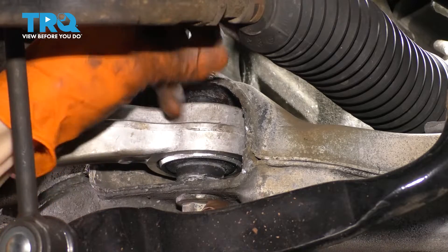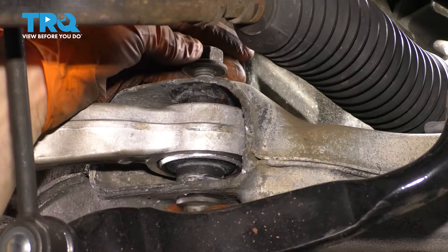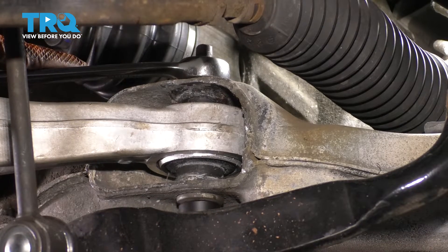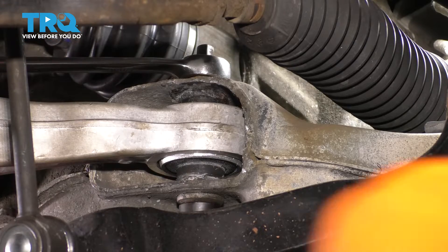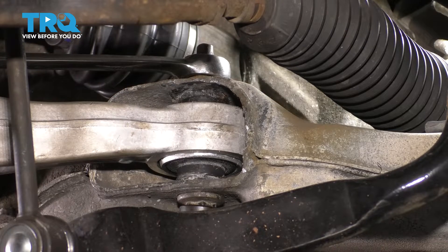At the top there should be a little spring washer — put that on and then the nut. Hold the nut and tighten the bolt. The torque for this is 65 newton meters and then 180 degrees, which is basically half a turn. 65 newton meters converts to about 48 foot-pounds. Let's hold the nut side and torque the bolt side — right there — and 180 degrees.